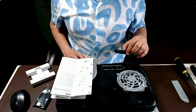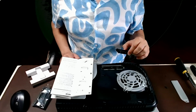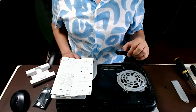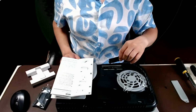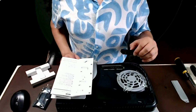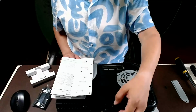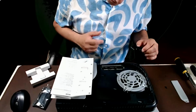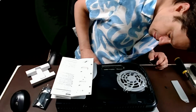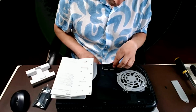Taking care that the spacer does not move, insert... now I'm reading here. Insert the M.2 SSD into the expansion slot connector, and then align the end opposite to the connector with the screw hole. Wait, what? I guess I'll watch the PlayStation video. Starting diagonally upward, firmly insert. There's a kind of gap above all of the little connectors. That seems like where there's a hole. That's where I'm going to place it.